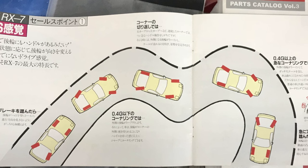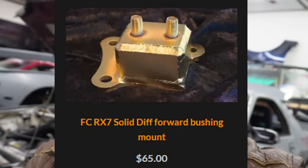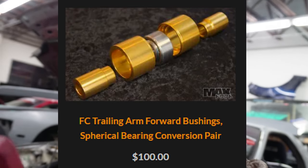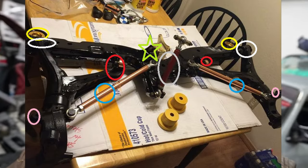The RX-7 was designed for cornering — the rear wheels turn to a certain degree, which is great for cornering but bad for drifting. That's one of the major things you need to address. I suggest getting the toe steering eliminator bushings from Parts Shop Max and replacing all the old bushings in the rear. You can get solid diff forward bushing mounts, solid diff riser bushings, spherical bearings, conversion pair, trailing arm rear upper bushing pair, and subframe risers. Once you replace those bushings, you're close to achieving a very solid rear end for the RX-7.